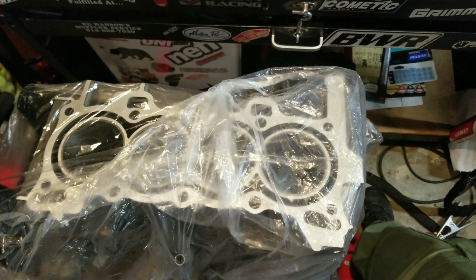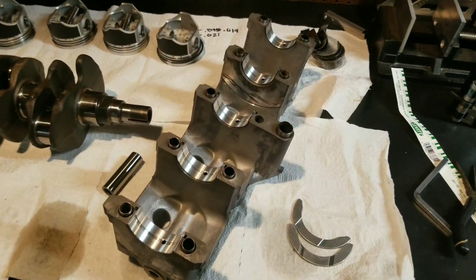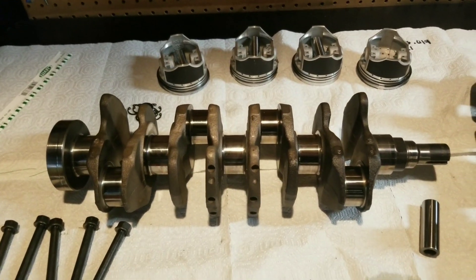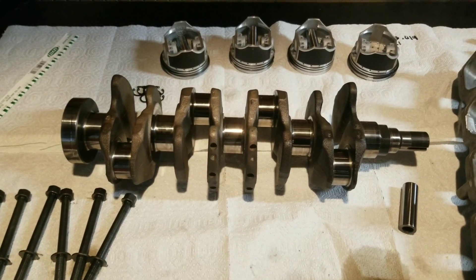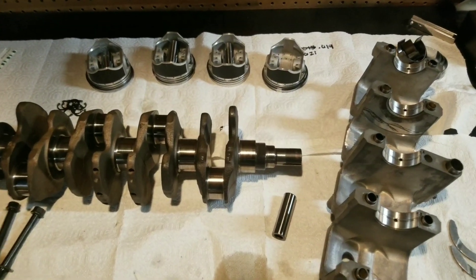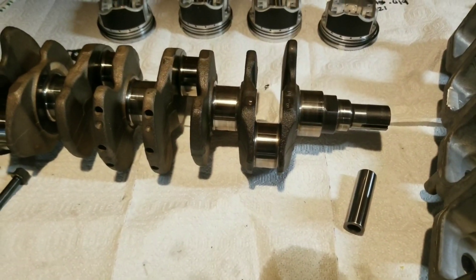The rings are lined up in accordance with the block. With the girdle, I've already got all the bearings installed, and the bottom end of the block has all bearings in as well. That way when you set the crank in there you can plastic gauge it, which I've already done, so all the tolerances are good. Next up is installing the pistons, getting the rods in there and clamped down, and I'm also going to plastic gauge the rod end of the journal.